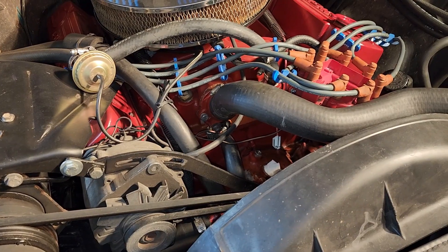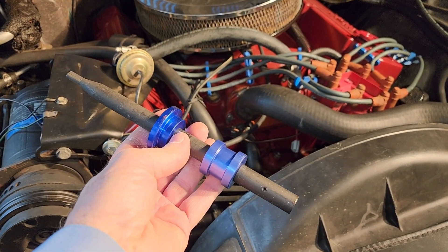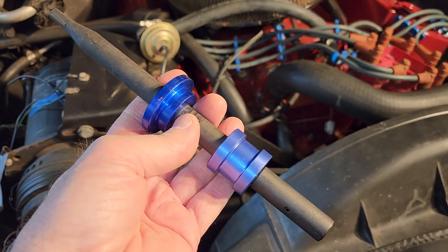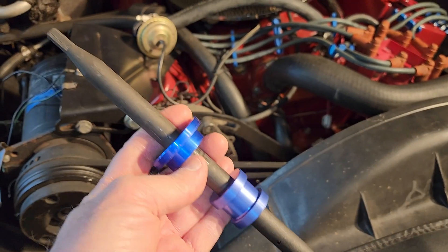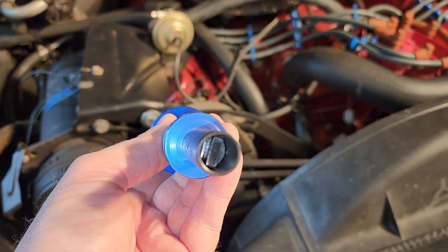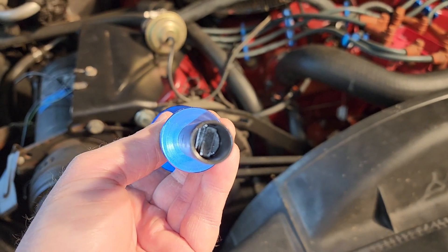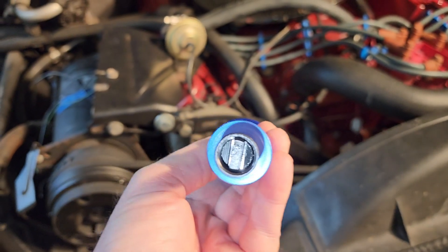What was good about that is I had to pull the distributor out because I bought one of these tools on Amazon for priming the oil pump. It was really rated for Chevrolet engines, but it fit in there really nice. That inside flat in there, I had to machine down a little bit so it would engage the oil pump drive shaft. I did that on a mill — I'm a tool and die maker, so it was easy enough. You can see how it's machined, that flat that creates the key.